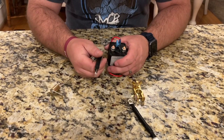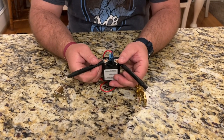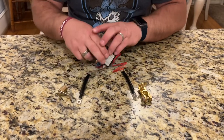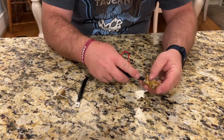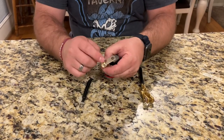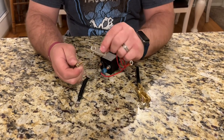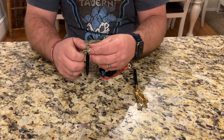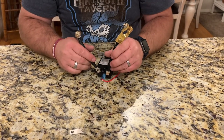This is going to be fairly straightforward to assemble and install. You're going to take the two wires, connect one to this terminal on the relay and one to that terminal, then connect these two to each of these two leads. You'll use this little wing nut and slip it over like that for one side — this is the part that connects to the negative terminal of the battery. On the other side, you can unscrew this screw, and run it through and screw it in. With these two connected like this, that's how you're going to disconnect the battery.